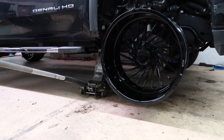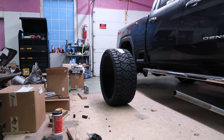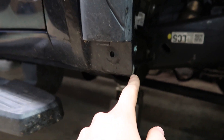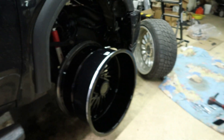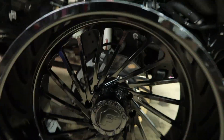I got them thrown on and I'm sitting here thinking — why didn't I do 26s way sooner? These things really fill out the wheel wells a lot more than the 24s did. The only thing I'm getting concerned about now is turning — I had full lock-to-lock turn with the 24s, but with these the valance and the cab are going to be a problem. I did rub slightly taking a turn super fast. The last thing I want to do is cut my cab — I'm not a fan of that. A lot of places were closed this week for Christmas, so hopefully next Monday or Tuesday I'll get these mounted up for next week's video.